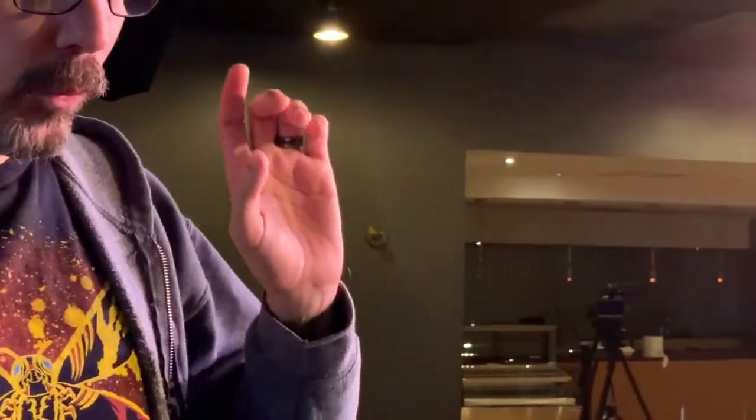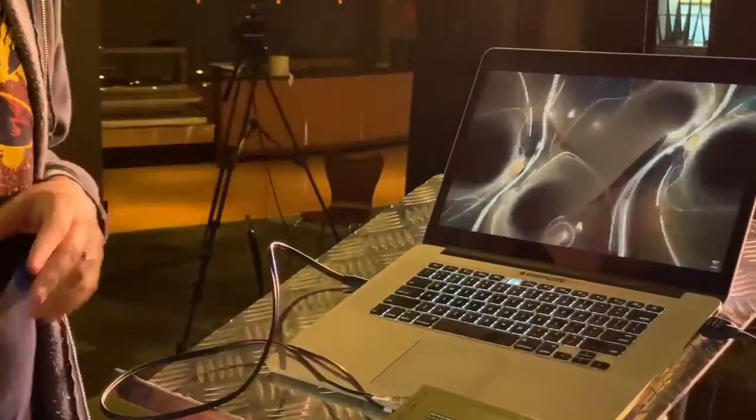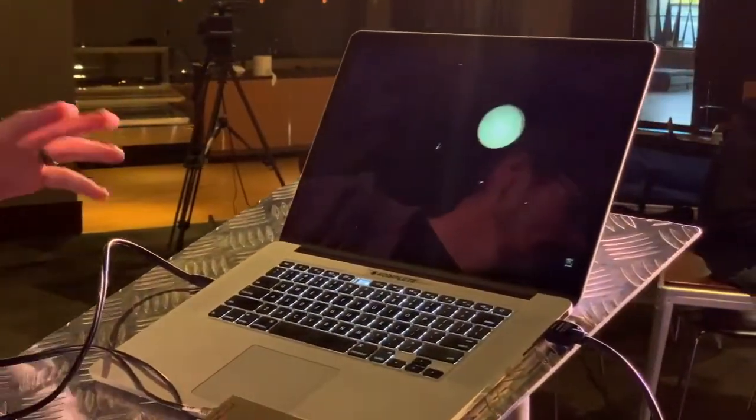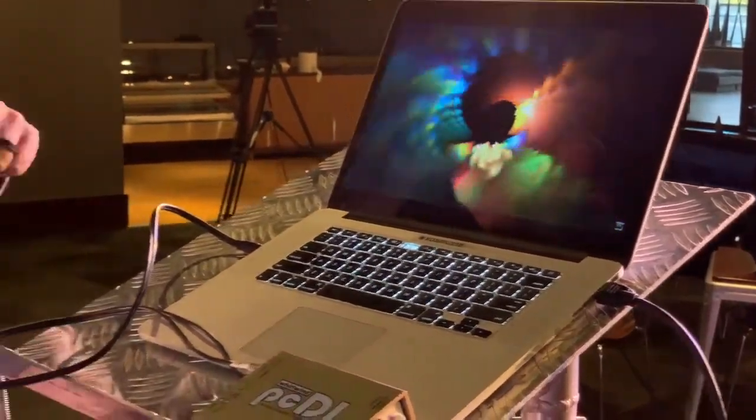All right. So that's our hookup. Now, one last thing you need to be aware of. When you're hooking up to this particular system, it's kind of an older projector, so you need to make sure your output is set to 1080i. If you do it any other way, you'll have problems. All right, and that's your generic video hookup here in Treehouse.